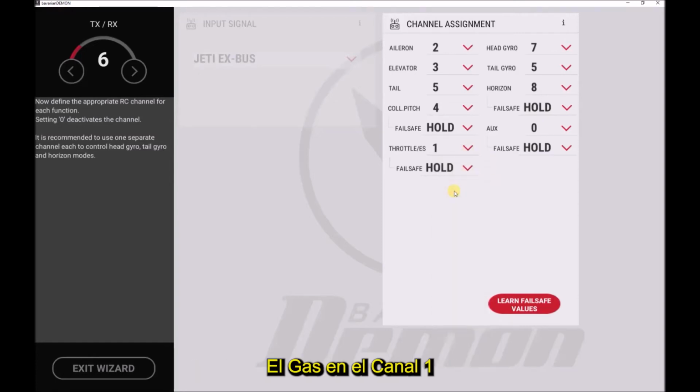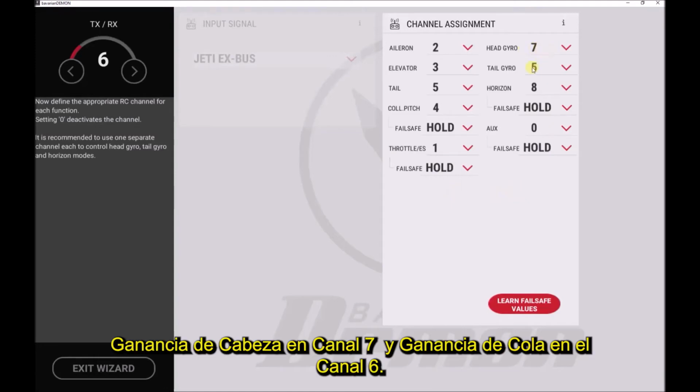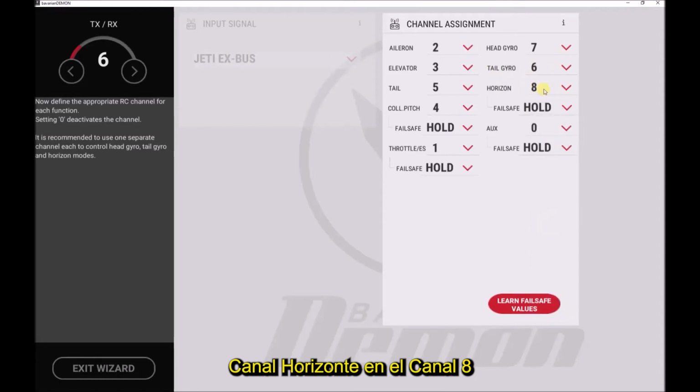Throttle in our case is applied on channel 1. Head gyro is channel 7, that's correct. Tail gyro is on channel 6. Horizon channel on channel 8. That's it for the whole channel assignment.